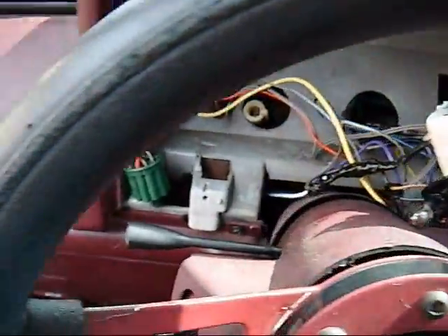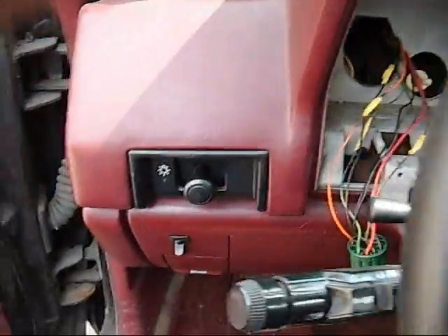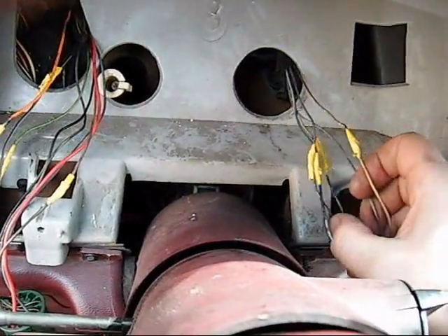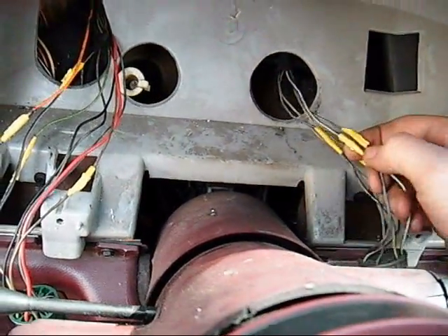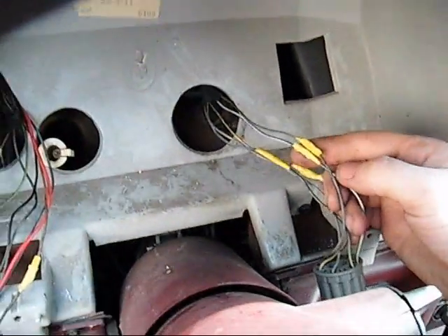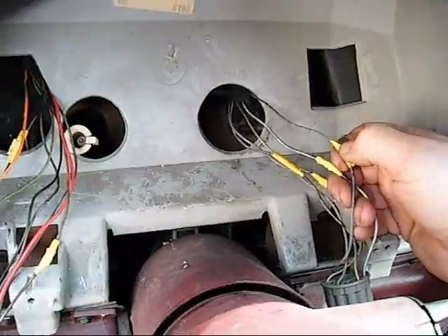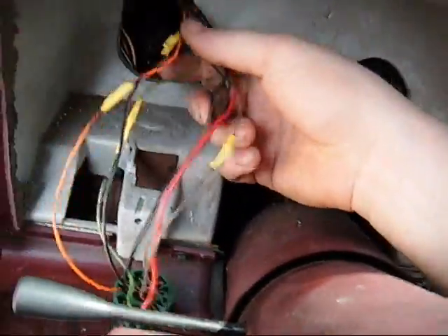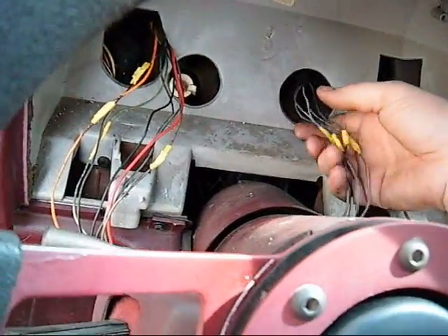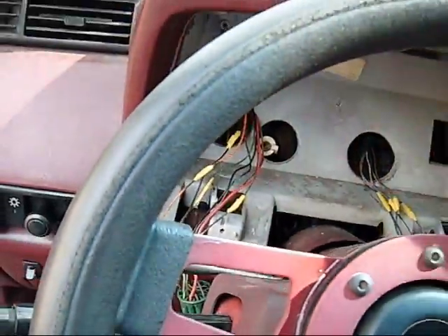I've removed the wiring I did and taped it up. Almost all the wires were never actually cut - I just removed some plastic. Sometimes when you do that you will break the wire, but that's not a big deal - you strip it and tie it back together. I've cleaned it all up. Before I put the dash back in, I'll put some more tape around to bundle it all together and keep it as neat and clean as possible.